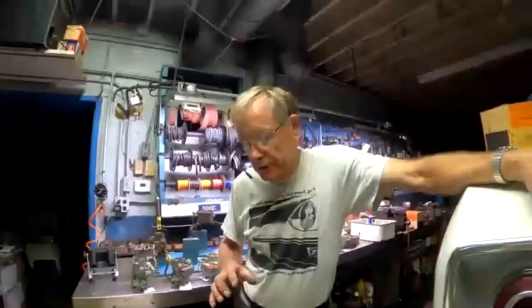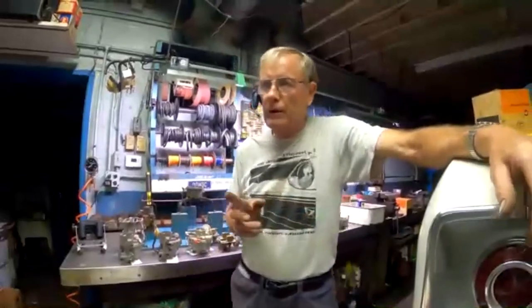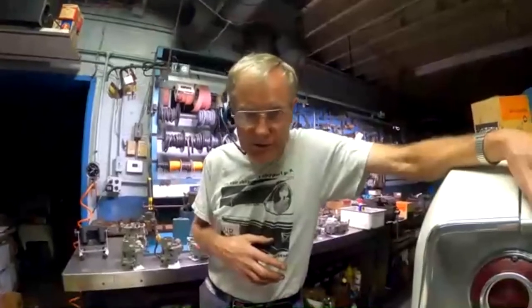It's just not accelerating. If you really push your foot down, oh, it'll go fine. But just trying to ease into the throttle, that typically means you need to go up in jet size. Typically, going up 1,000ths isn't going to make much difference, but 2,000ths, don't go in 3,000ths or 4,000ths steps, but 2,000ths bigger than what's in there will probably cure that. And a lot of that is caused by the type of fuel that we have to use today. It's not 1966. We can't go down to the Sunoco station and fill her up with 260. So. All right, let's catch another one here.